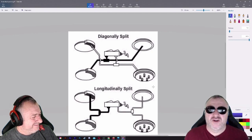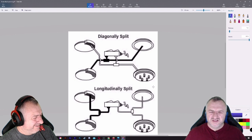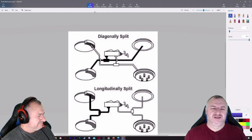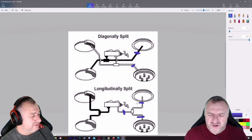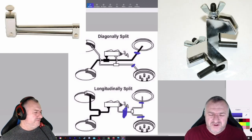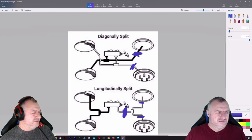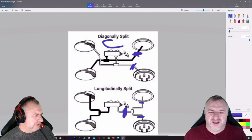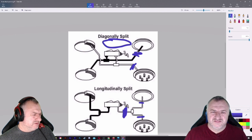Well, if you want to make sure fluid doesn't fly out everywhere, so what we can do to stop the pistons from jumping out is use some hosepipe clamps. But on this system, you're going to need two hosepipe clamps for each wheel. If you must, put a cable tie around the wheel cylinders. That's a good idea.